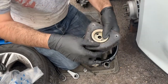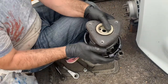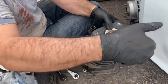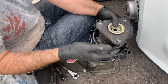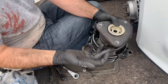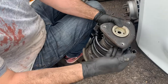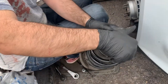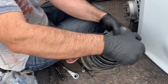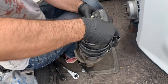What just happened in there is that, unlike on the other side where I removed the suspension mount from the top, in this one I removed it from the side and completely forgot what I had in mind before: be careful and don't pull it out from the side — it has to be from the top. Otherwise you can split it and, as you saw, the ball bearings all start to come out. Luckily it was just a few of them; I managed to clean them up, put them back in and click them back in place.